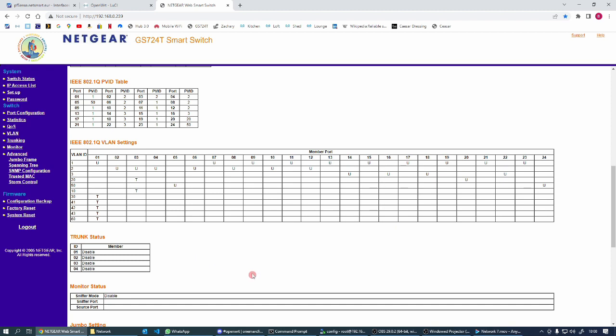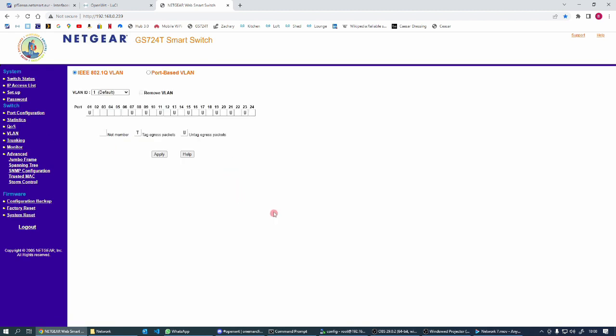Right, so the first thing then to do, there's nothing in that port, so let's go in and add the entries for the loft router. Let's go back to VLAN. That's going to be plugged into port 8. So that's going to handle 30. It's going to be tagged on port 8. 41, tagged on port 8. 42, same again.